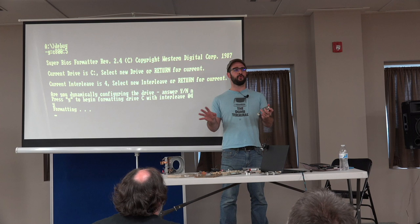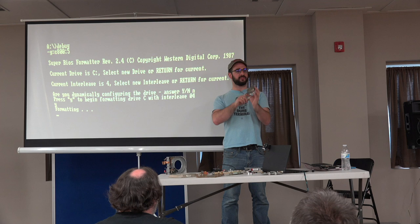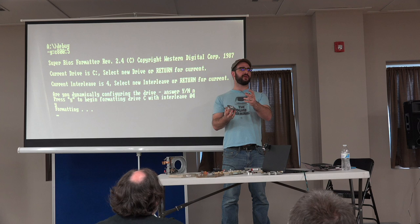And it was arranged a lot like this, where there was the big external magnet, the driver board underneath of it, and then bearings on the inside. And I used some Schaefer's Penetrol, which is a synthetic penetrating lubricant I've used for a lot of things. And I filled, there's like a lip around the bottom of this, and I filled it with the Penetrol, hoping it would soak in, but not that there would be so much that it flows through the bearing, goes into the drive, and gets all over the platters, because that would ruin it too.